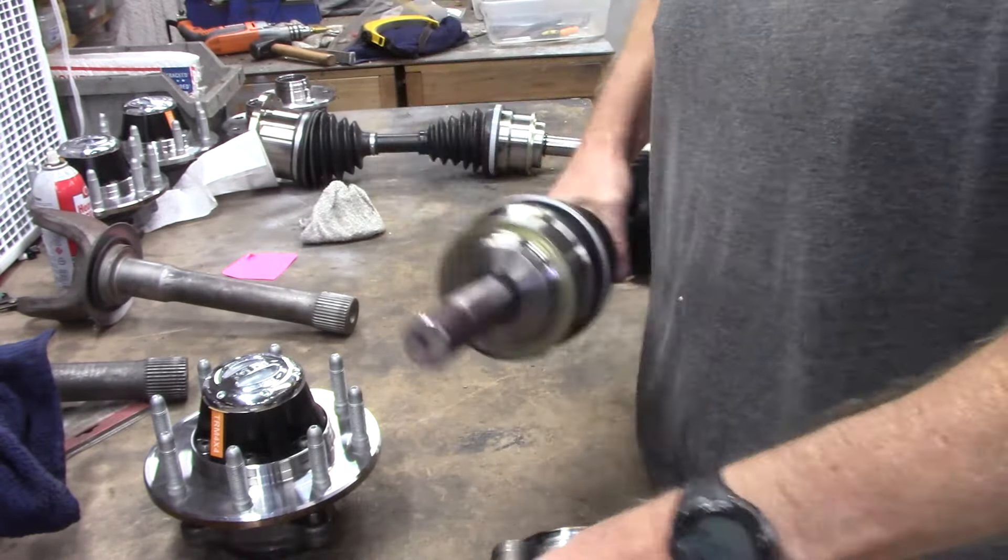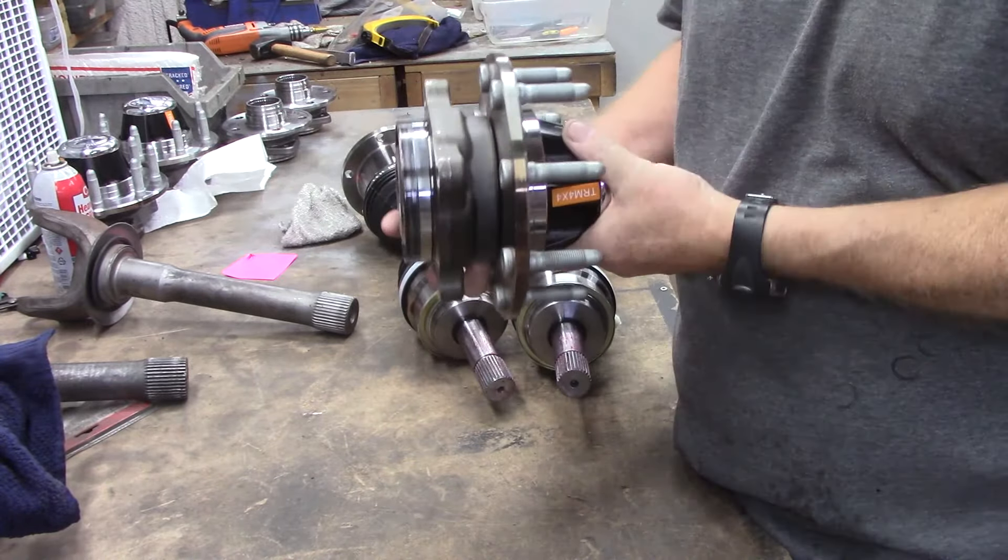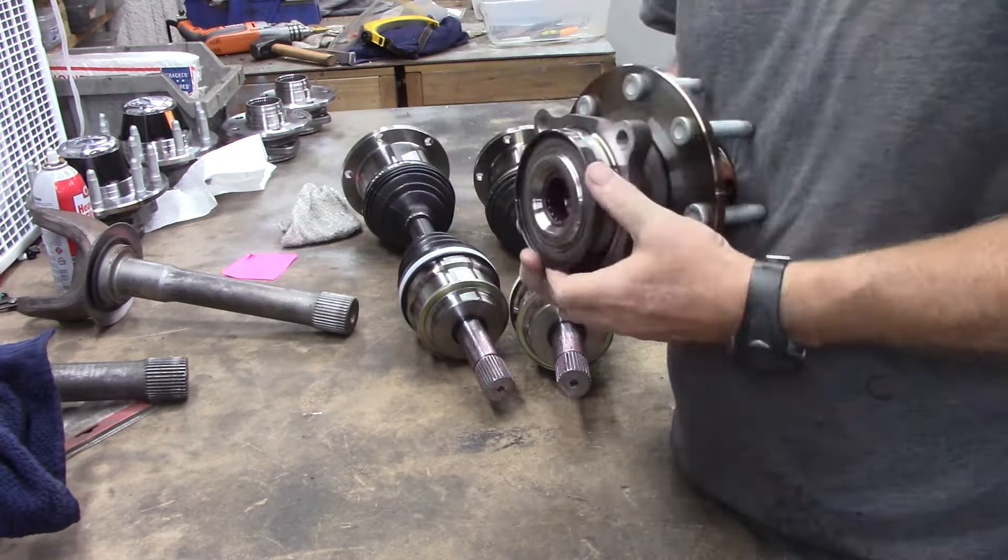Check our shafts and our bearings — oh man, that's smooth. And if you're gentle, you'll just get the splines inside the gear. What I'm showing is that these, like the Dodges, can be put on as one whole assembly. You can install the shafts and then gently mount up the hubs, rotating just a little bit and aligning the gears, and everything will bolt right up.